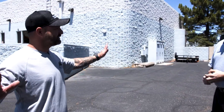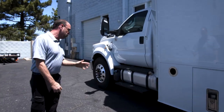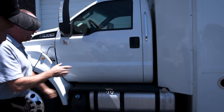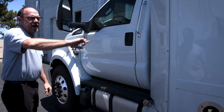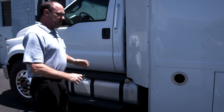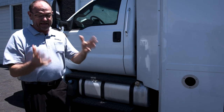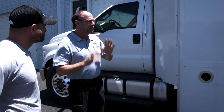This is the best heater on the market today — there is not another heater that does all of these things. Installation on this particular vehicle would be quite easy. There's a spare bung inside the fuel tank right here that's plugged up right now — our fuel probe goes inside of that, a ten-minute job. You run the line back to the heater and you have fuel. Power and ground come off the main system connecting to the battery. Then you have a switch harness that runs to your PFC on a CAN network — it's an absolute plug-and-play system. You plug up three wires in a harness and you're done.